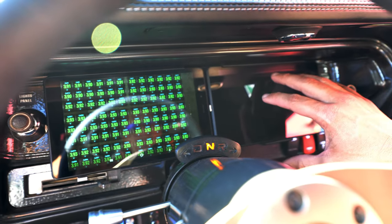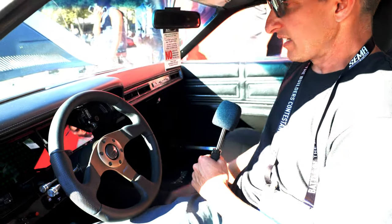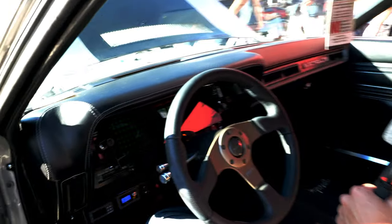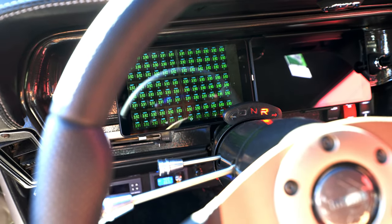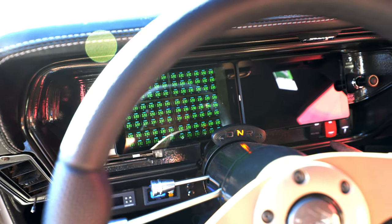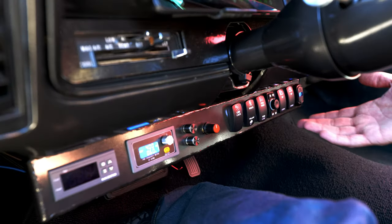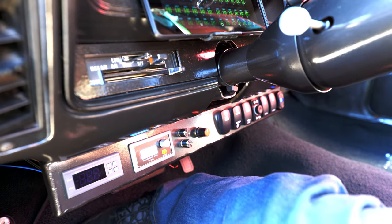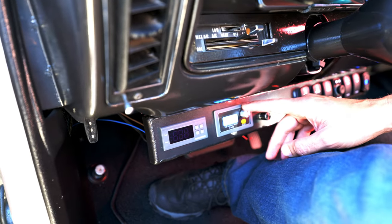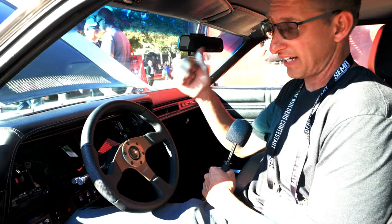I've got two screens here — one for the rear-view camera, entertainment, moving map, anything else you'd want. I 3D-printed the PRNDL: neutral, drive, reverse. I also have switches for regen on/off and neutral. The lower panel is very driver-centric: power windows, Bluetooth stereo, various lights, line lock, a thermostat, and PWM control for the AC compressor. On a moderately warm day I can run the compressor at lower speed to draw fewer amps; on a hot day you crank it up.